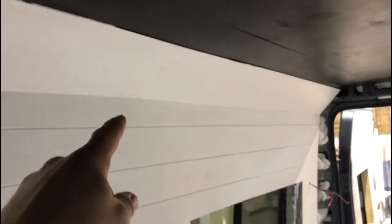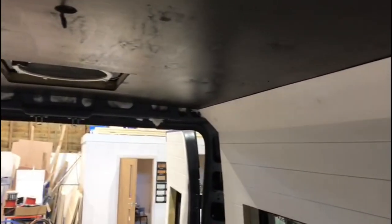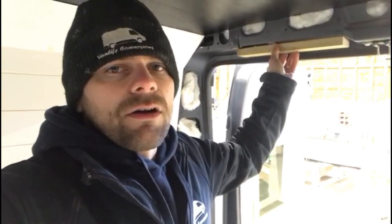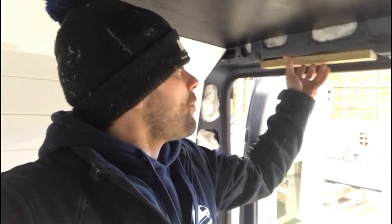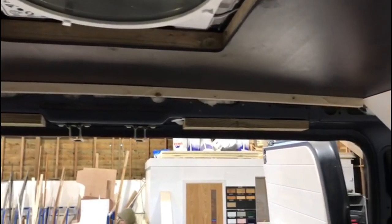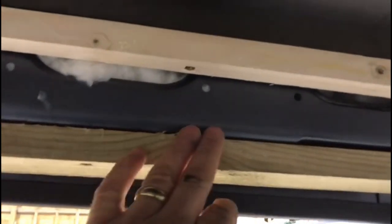Now that the coving where the ceiling meets the wall is installed on both sides, I'm going to box in the rear brake light pillar. I'll show you how I build out the structure for the plywood boxing in to fix into. For the first bits we're using 25mm by 50mm roofing batten, and I've done a 10-degree cut on the table saw running along its length. This allows the batten to sit nicely on the underside of the boxing-in structure so the actual boxing in can sit at 90 degrees — essentially taking away the angle of the van's metal just by shaping the wood on the table saw.